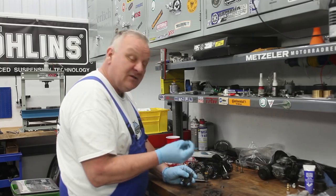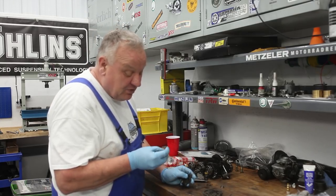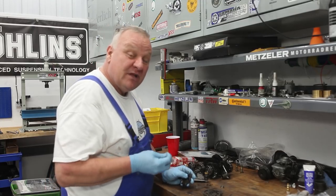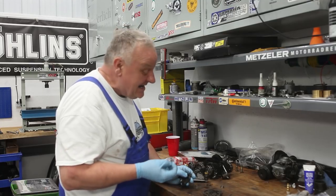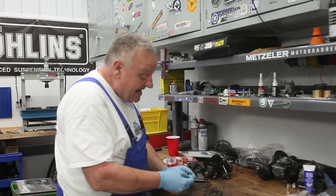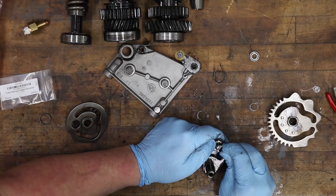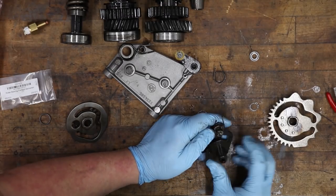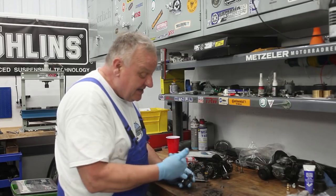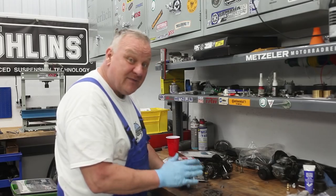Keep in mind with these little clips — in a perfect world you should replace all of them, but sometimes you can get away with reusing them if they snap on well and it's not a super critical application. This one came off nicely and snaps back on hard, so I'm going to use it. Keep in mind clips have a sharp edge and a rounded edge due to manufacturing — always put the sharp edge out. If the clip feels loose in any way, absolutely replace it.